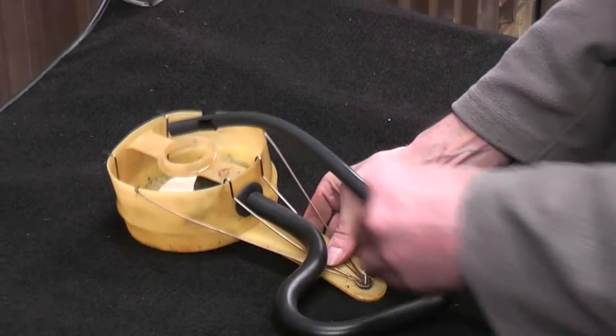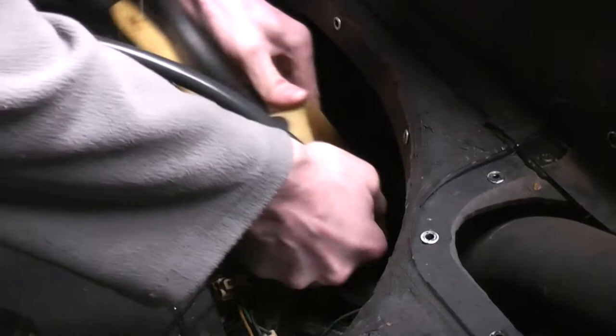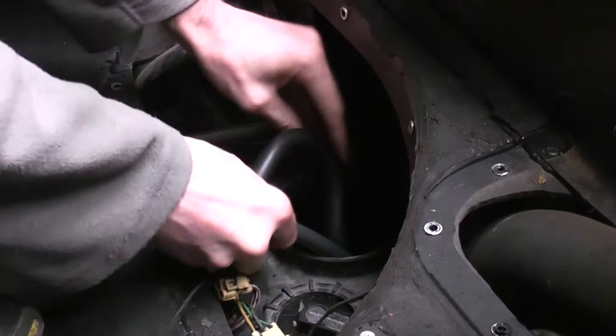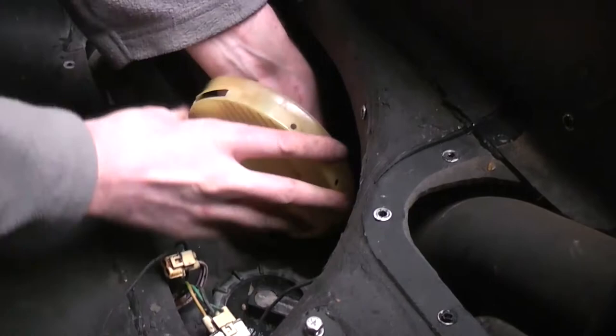And that's a reference of how the fuel tank baffle should look inside the tank — if you could see it, which you can't. Now let's put it in the tank. This all goes in in one piece. You have to squeeze the side of the baffle. In we go — like a glove. Two hoses in. Now I'm going to have a crack at getting the base on. The base kind of folds sideways.